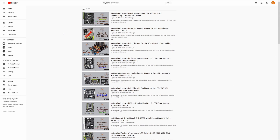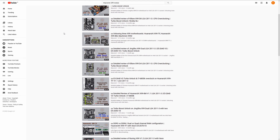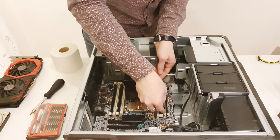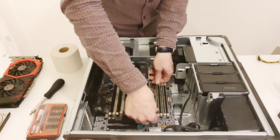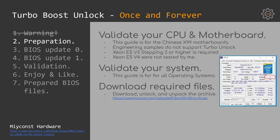Personally, I have tested Turbo Boost unlock on all Chinese X99 motherboards I have tested, as well as the MSI X99A SLI Plus motherboard. This should also work on any other X99 motherboard if you have the ability to flash a customized BIOS. Some pre-built systems such as HP or Dell have BIOS write protection and you might not be able to overcome this. Still, if you are able to override the BIOS on your motherboard, it shall work. Unlike the previous guide, this guide is operating system independent.